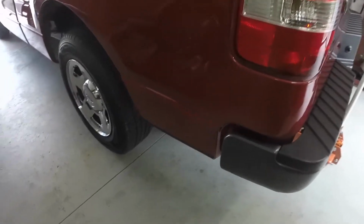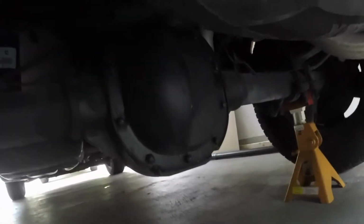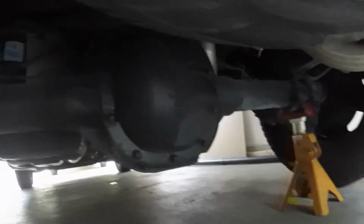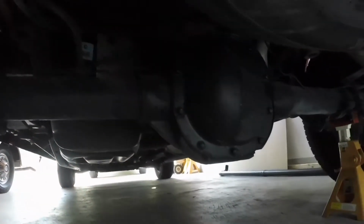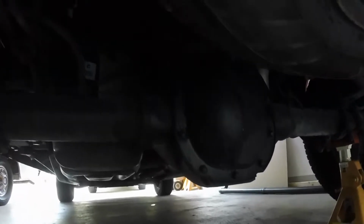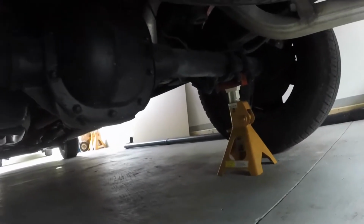This video is going to be on changing the axle seal in a 2008 F-150 with an 8.8 inch axle. First thing you want to do is get it up on jack stands, both sides. You got to pull this tire and brake assembly, but you got to take that cover off, and you got to be able to turn the carrier, so the drive shaft has to turn, so you want both tires clearing